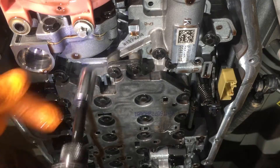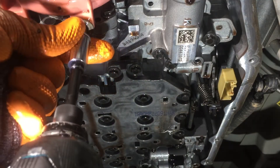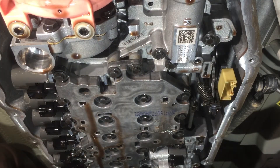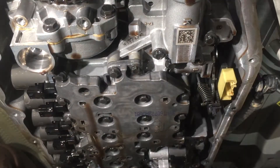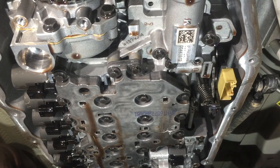For the rest of these bolts you'll need a low-profile Torx socket — they're kind of hard to find. You can get a regular Torx Plus socket and grind it, but I'll put a link to one in the description. These two bolts are for the oil pump baffle; they are torque-to-yield, so you need to replace those. What you're looking at here is probably the most aggravating part of this whole thing. The oil pump on the transmission is chain-driven, so you have to take this little spring clip, pull it away, and that releases it so you can slide it off the splined pump.